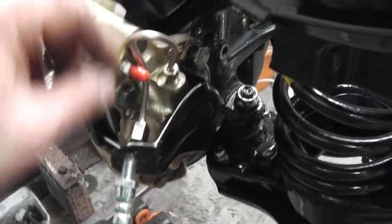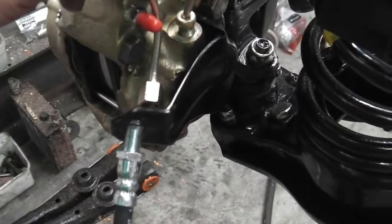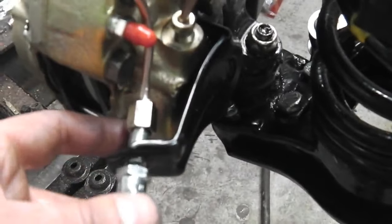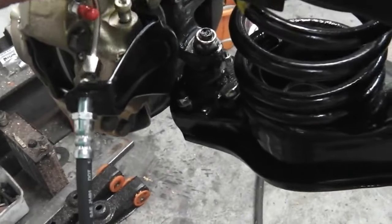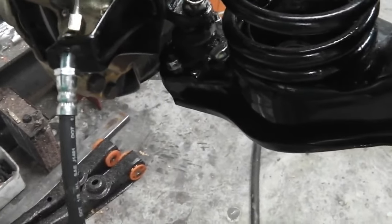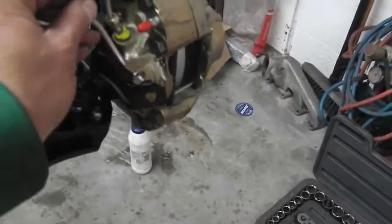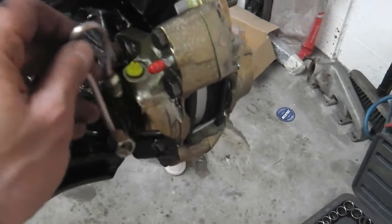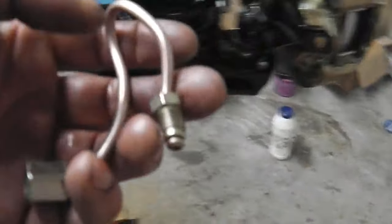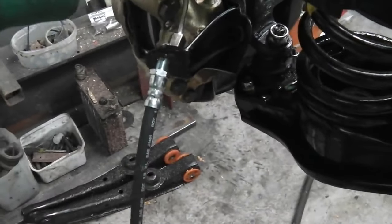There's no other real way it could go. I mean, this could be a tighter curve and it could drop down and loop back up from the bottom. To me, that would seem the right way as opposed to this way, but I don't think the fact that it's coming up is going to be a problem. So we're on there with a brake line. We do the same for this side. It looks like that would suit with the bend the other way. So we're going to make one from this, but curving the other side. That's probably the hardest brake forming we've got to do.